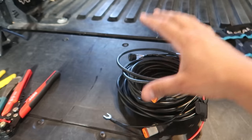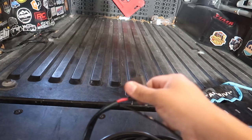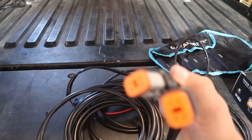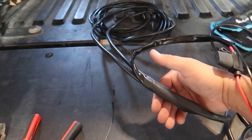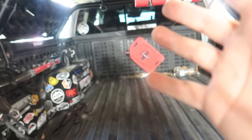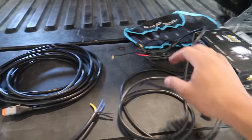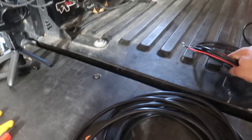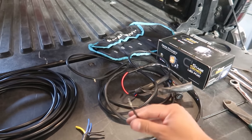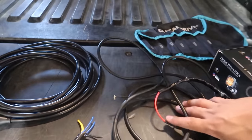Here is the four-pin Diode Dynamics harness. I have an Aux Beam switch panel installed on the truck, so I won't need the included switch or fuse. I'm just keeping the ends with the connectors for the actual pods. I'm going to cut the wiring off at that point and connect it directly into the switch panel. The plus and minus — red and black — and the fuse: I chopped that off since I have the Aux Beam switch panel. If you don't have a switch panel, connect red to your positive battery terminal and black to negative, then route the switch inside the vehicle through a grommet.